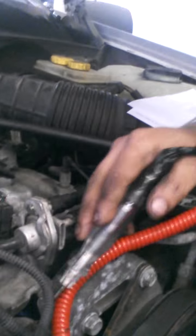So after looking around and doing all that good stuff, remember I told you that this wire was intertwined with other components. A long time ago, I remember watching a video on Scanner Danner, and he said look on the intake and exhaust manifolds. Sometimes you have wires there that might touch. And guess what? Right there, we have a wire.